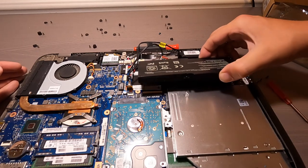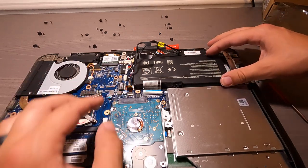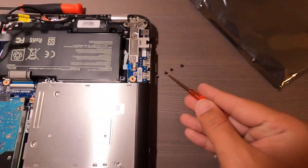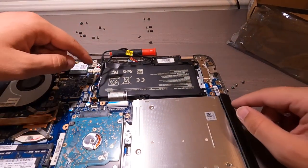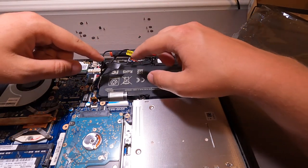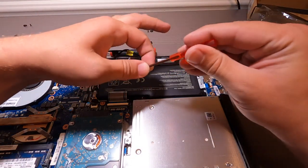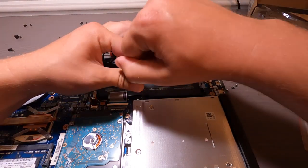Okay. Now, move that ribbon. Make sure I've got everything in. Okay. Now, I'm just gonna take my 4 screws right here, and I'm just gonna put them back in, okay? Go real gentle. And then right after that, I'll have to find a home for all of these wires here. Take some electrical tape, make sure they're secured. All right, first things first. I'm not gonna tighten them down. I'll just get them a baby snug. Baby snug. Just get those threads started.